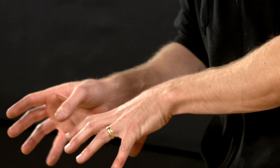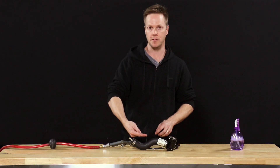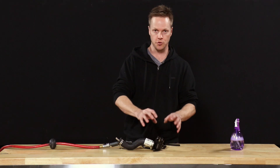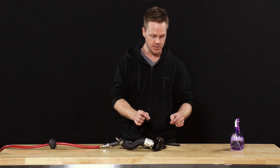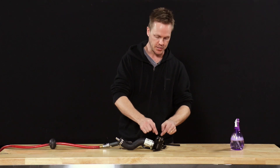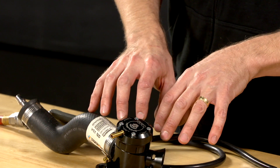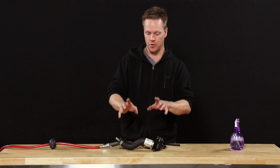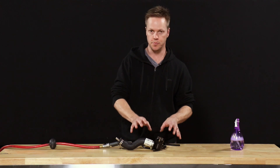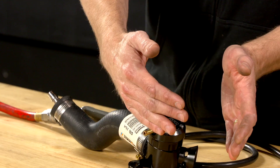But in pressure testing the car, because we're putting pressure in the turbo intake, it's also going up the recirc outlet of the blow-off valve. Now in the case of any dual port blow-off valve, exclusively they use a piston in a bore. The reason for that is because you have to shut off and isolate both the trumpet and the recirc port when the valve is closed — you cannot do that with any other style of valve. When you pressurize the recirc port of a dual port blow-off valve, the air will be able to force its way around the side of the piston.